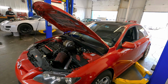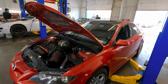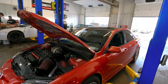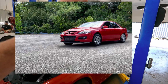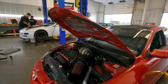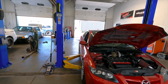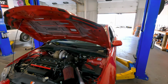Definitely at the track, we're probably going to bring them down to like 15 in the front and 18 or so in the rear, but the transfer of weight into the back is heavy. I mean, this thing slammed. We'll get a still shot pulled up on the screen, but you can see how crazy the back wheels just sucked up into the wheel well. But like I said, I got those drag springs and rear spring adjustable perches. Those will be going in this week, but we figured we'd get a baseline now while we had everything we needed to get it to launch.